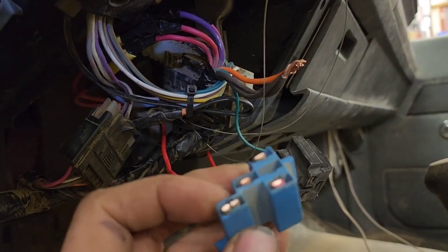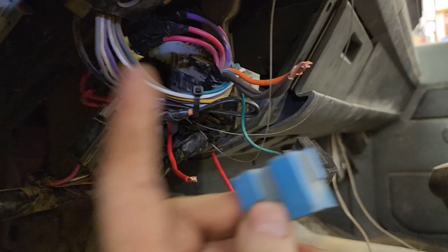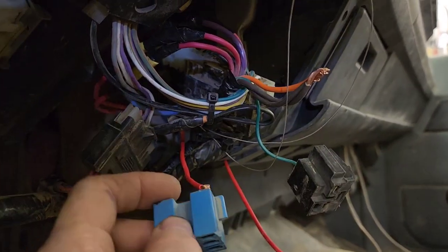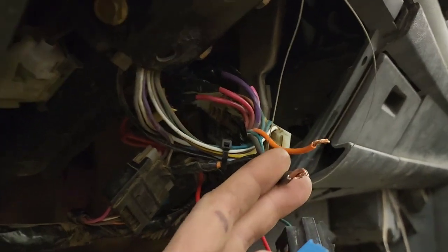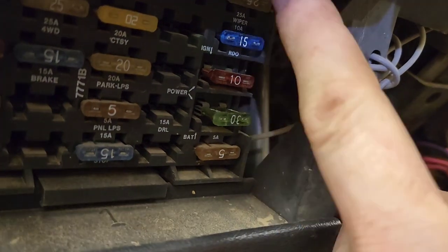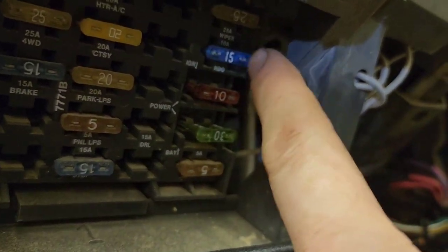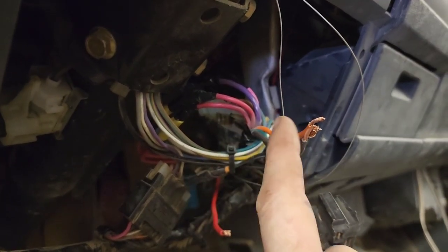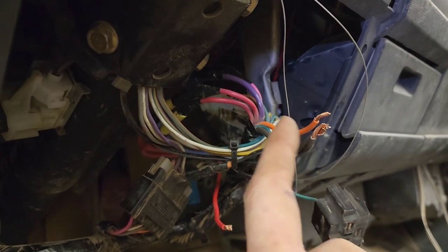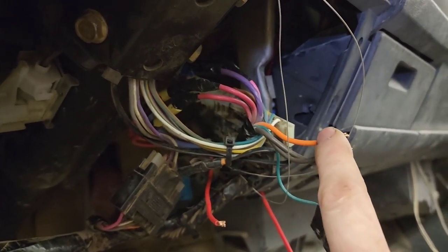I messed up a tiny bit — there were two grays going back to a plug that came out from the top of the steering column. Those two grays send power over the fuse block for the row which has the radio and the windshield wipers, which we need to work. So I'm back down here reconnecting the gray and I'm going to combine it with the orange.